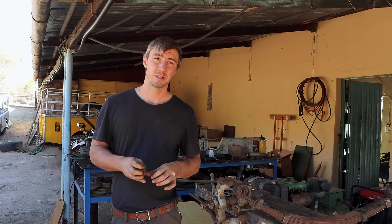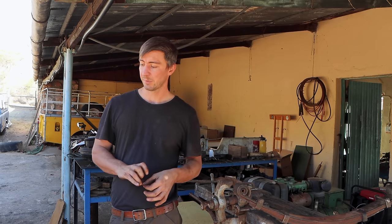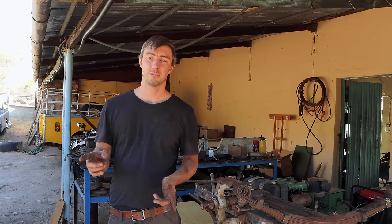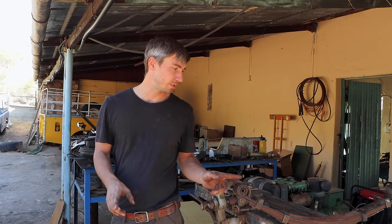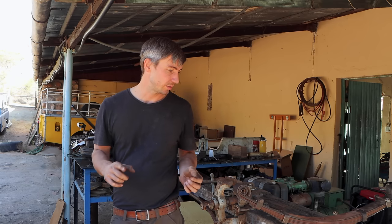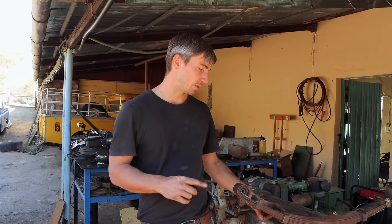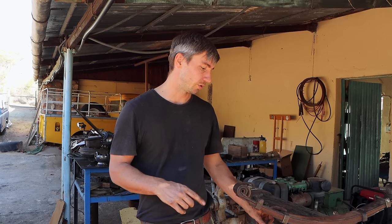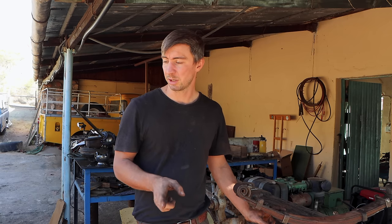Mark was here on Sunday. We discussed how we go forward with the car. Yeah, he's really happy with the axle. We need some brake lines. Right now we need to swap the springs from left to right because the clamp position that holds the springs together is bad. They are touching the steering rod. We're going to change that, and when the brake lines are here the car should be good to go.